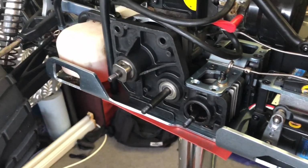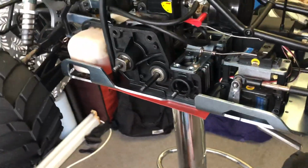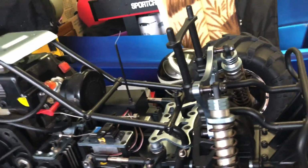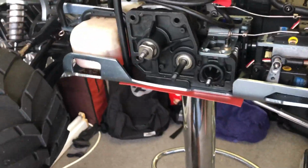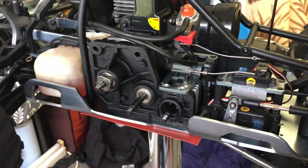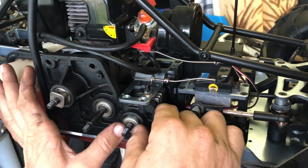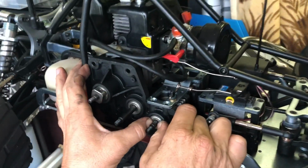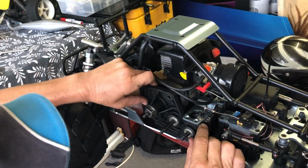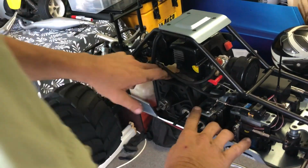What I might do is get a little rag and see if I can clean a bit of crap out of there, so the bearing can seat back in there nicely and run true. All good, beautiful. Okay, bearing back in. Maybe I should have pulled that bloody bearing out before. That's okay. Back in, bang, look at that. Good as gold. All right, so what I'll do is put these screws back in.